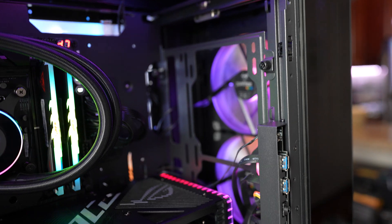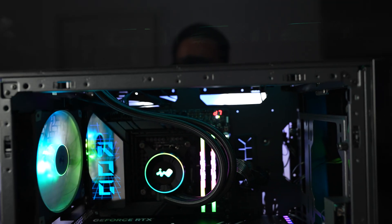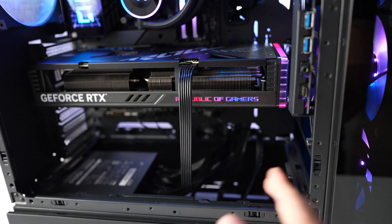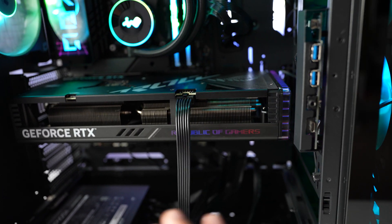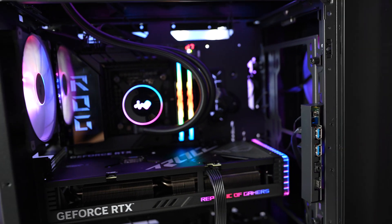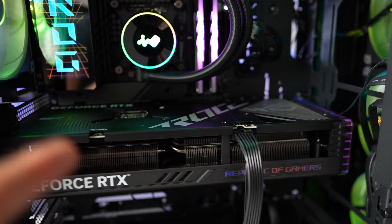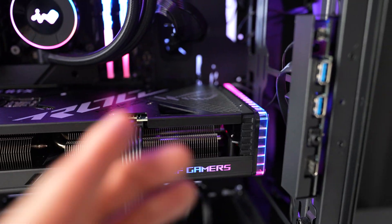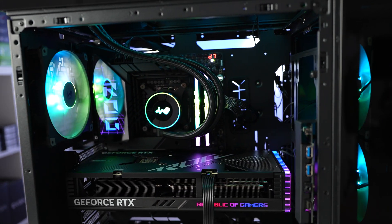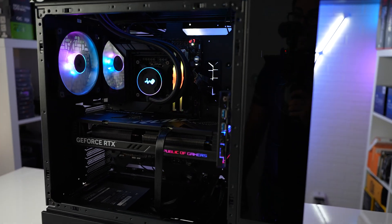Looking at everything inside: we've got three 140mm fans in the front, a 140mm fan as exhaust in the back, three 120mm fans where the radiator is at the top, and the PSU at the bottom. I kind of wish the bottom was covered up with a PSU chamber plate to hide those cables, but I'm sure somebody will figure out something clever to hide them. Overall this build came out really nice, and there is so much room in this case — even a 4090 would fit in here with room to spare. It's like an open canvas. Now let me show you guys the backside of this chassis.